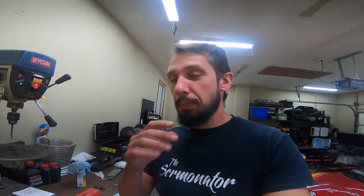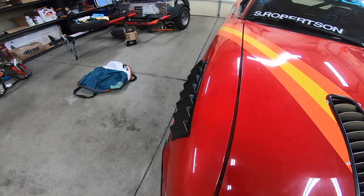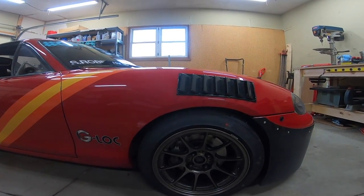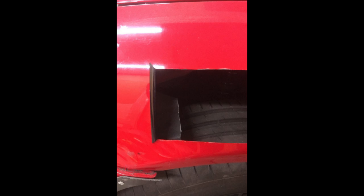Keeping the introduction brief — this is a follow-up video to the professional awesome fender vent installation on the Miata. Products are supposed to work, but it's hard to tell unless you test them yourself. In the previous video we tested pressure on the top and below the fender to find the best vent placement. The farther forward the vent was placed, the more negative pressure it would see on top, so we put it as far forward as we could.